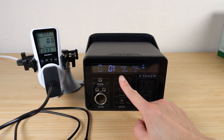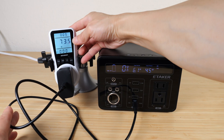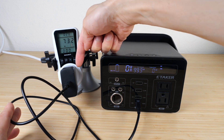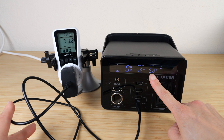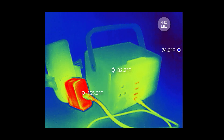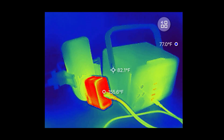Starting from 0%, I used the included 65 watt USB-C power adapter to charge it. It drew about 73 watts at the wall. There's some conversion inefficiency — roughly 75 watts going in, 65 watts out of the adapter, and eventually 58 watts reaching the internal battery. After about 45 minutes it had charged to around 15%, and the AC adapter warmed up to about 155 degrees Fahrenheit, which I'm told is normal behavior.